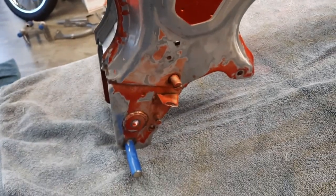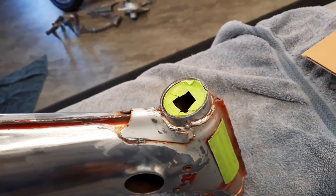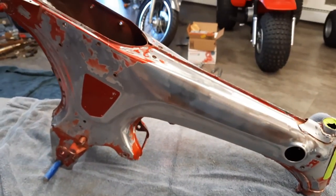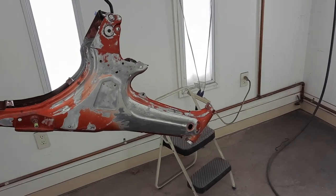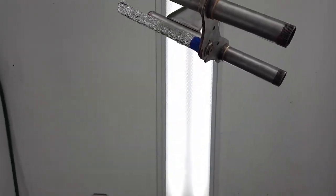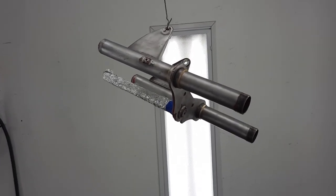After it's painted I'll do that again, probably, depending on if they go in nice and smooth. Now I've got the surface area that the brake rides on taped off, and the front VIN number and the races taped off. I'm going to sand where it's shiny on the paint and get it ready, then move on to prepping the swing arm and the front forks and anything else that's going to be painted red. We're down in the paint booth - the frame is ready and these forks are ready. I'm going to hit them with self-etching primer.